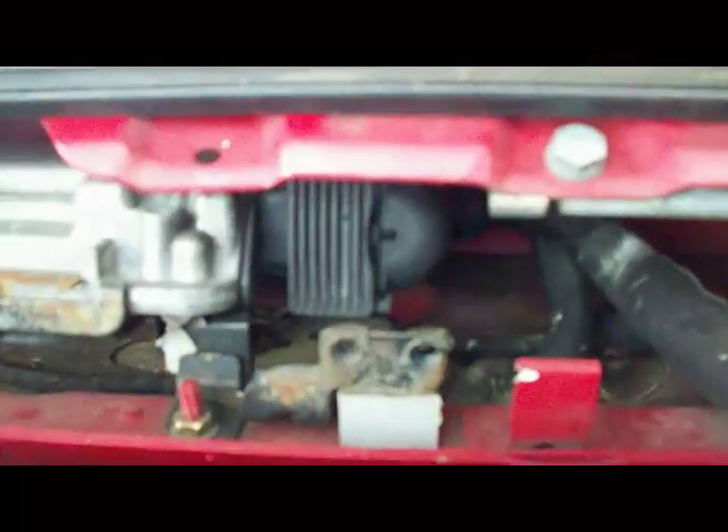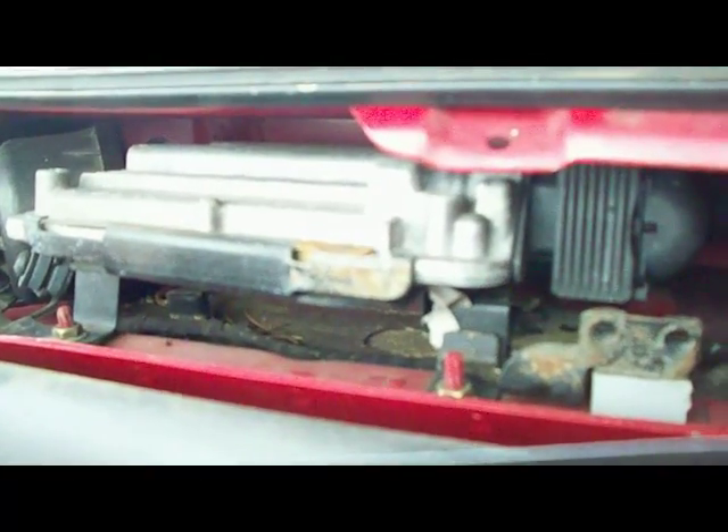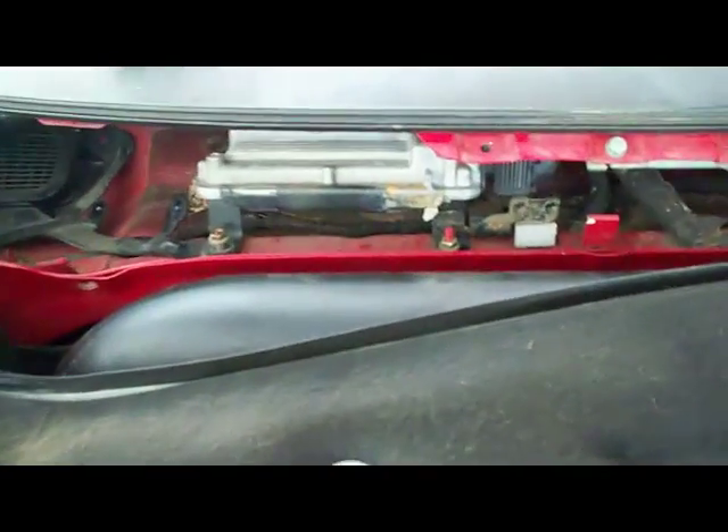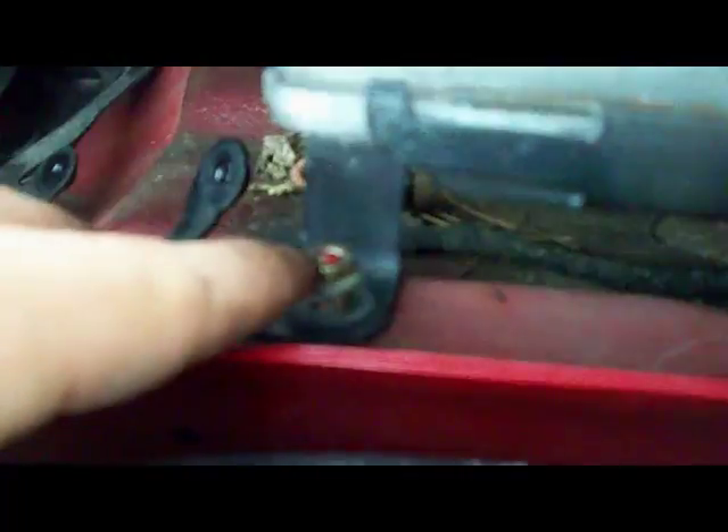If you all have the noise delete piece, you'll have that little guy here, unless you've taken it out — which I'm actually about to do right now. I completely forgot to have that left in there. I haven't taken this out in about two years. All right, now it's time for that sweet ECU removal. We've already got everything out of the way that we need to. You're going to have these two little nuts down here. They're both 10 millimeter. You don't have to pull them all the way up and you don't have to take them off — I just did that to show you. But as you can kind of tell, it's slotted. So all you really have to do is slide it out like that.